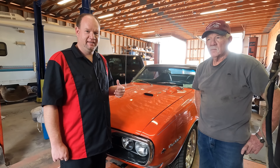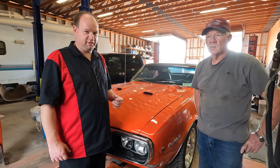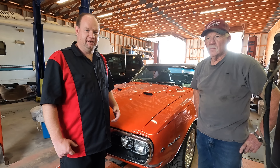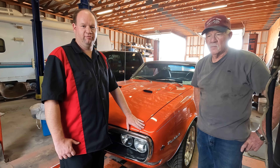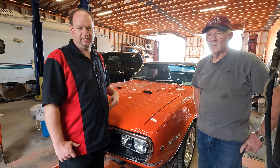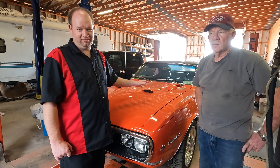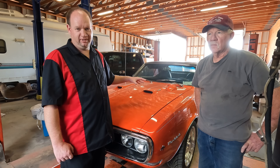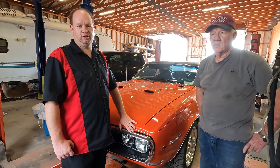The exhaust leaks a little bit, and where we live we can go in a range of elevations from 2,000 feet to 10,000 feet. It's currently carbureted, so what we're going to be doing on this one is a full fuel injection system, redo the cooling system, and redo the exhaust. Possibly in the future we'll do a 5-speed conversion and replace the rear end. When I got the car, somebody put a 7.5 10-bolt in it, which just isn't going to handle the power this thing has.